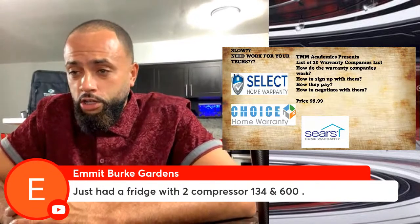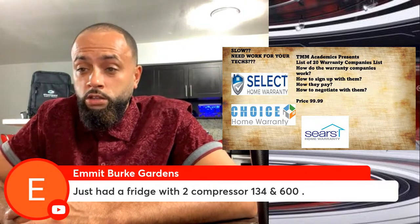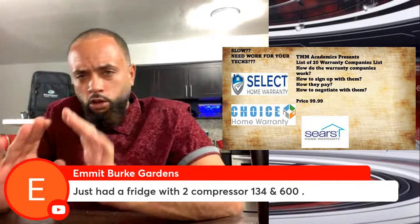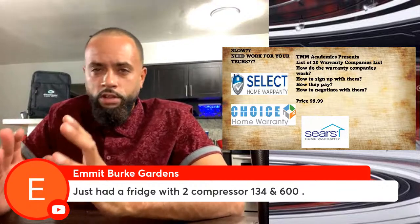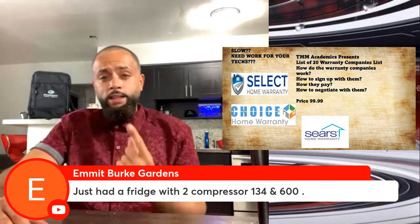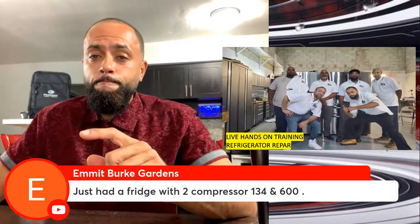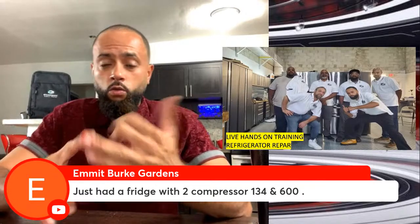My man Emmett, what's good? Emmett says he had a refrigerator with two compressors, 134 and 600. Look at that, y'all. Now, for those just coming into the industry, not really fully immersed in appliance repair, let me explain what this brother's saying here. He's saying that inside of one refrigerator, not two refrigerators, inside of one, there are two systems. One with a 134a and one with R600.